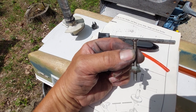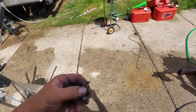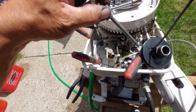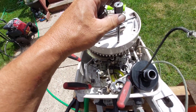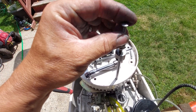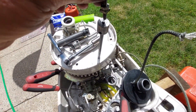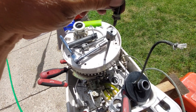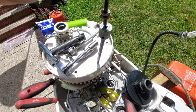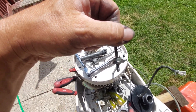This is my special tool — I plan to make one more like the factory version. There are different shafts, so find the thread on the shaft you're working on and get yourself a screw with the same thread. Put two nuts on it and turn it down in there — it's right-hand threads. Then tighten it with the jam nut, because when you wind the spring you've got to turn it counterclockwise, which will unthread it if you don't use the jam nut.